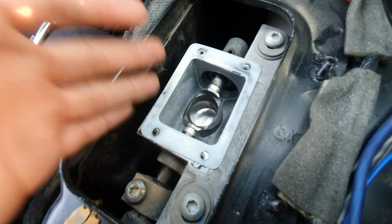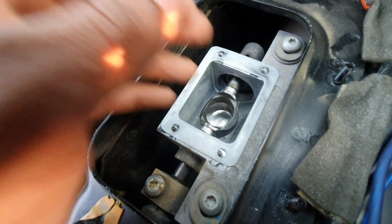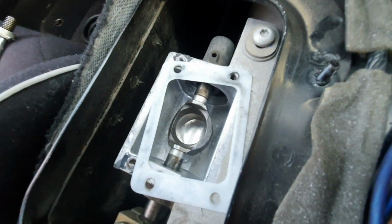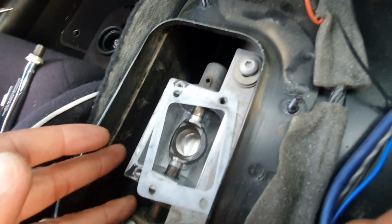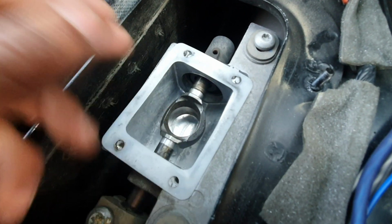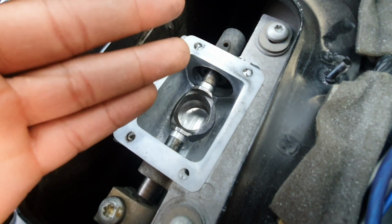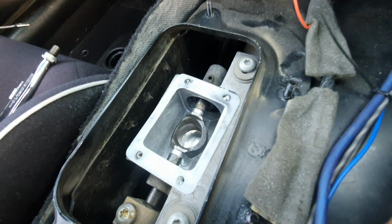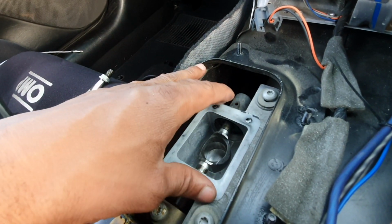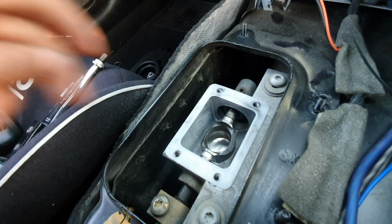You'll also notice right here, when you guys are doing this, if you were driving your car a bit before, that your transmission tunnel is warm. That's because your torque tube is literally right here, underneath that. That heat that you feel when you're driving over long periods of time, that's where it comes from. Your drive shaft pretty much is coming straight through here by your legs. So I'm gonna go ahead and remove this now, and then we'll start with the install process of our new shifting mechanism into our new box.